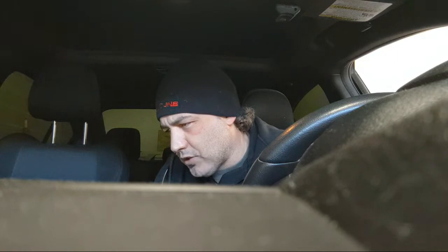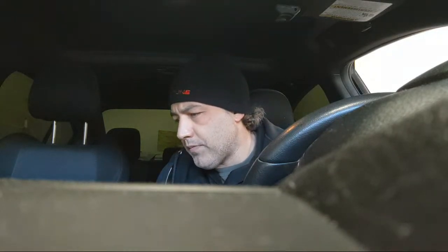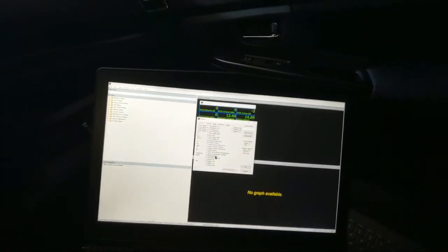Intake temp manifold. I also want to get intake temp at the MAF because I want to make sure that I have the same differential temperature across it. So I'm going to select that really quick. I'm going to get somebody here to hold the camera, my cameraman, so you guys can see this stuff too. Intake temp pre-turbo. We're going to do manifold pressure. Here, I'm just going to show you that stuff. Check it out. You guys get the special stuff. Alright, we just could do, I don't care. Well, I'll look at that one. Why not? Look at that.